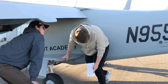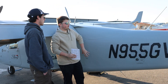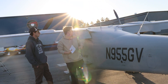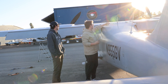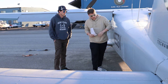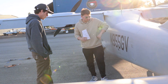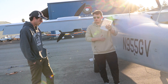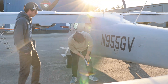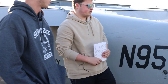From there, we'll move on to the actual fuselage itself — just walking alongside, doing a normal condition check, looking for any weird dents or anything that looks like it was damaged from a previous flight. We've got our ELT up there and our GPS radio in the back. Everything looks good. One thing we're checking over here is the landing gear hydraulic compartment — what holds all the hydraulic fluid for the landing gear. There's a little window down here — double-check to make sure we have at least 20 bars. We've got 40, so plenty right there.